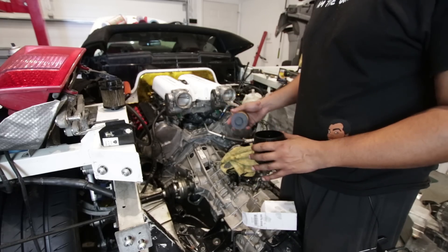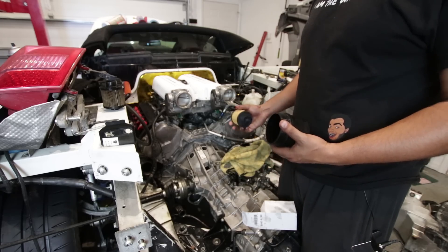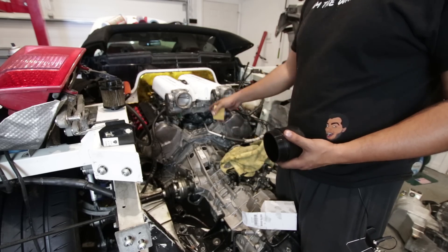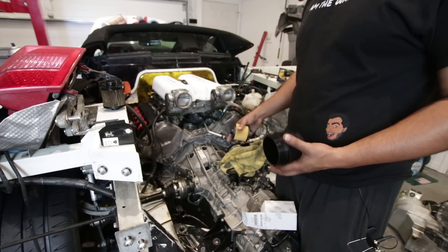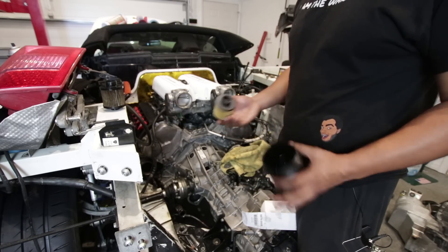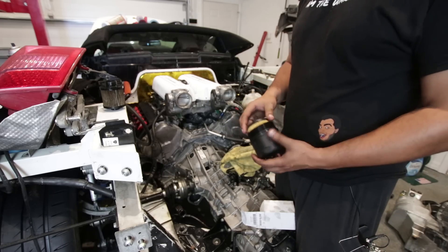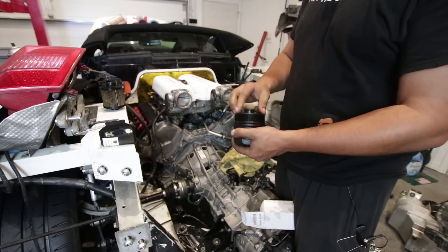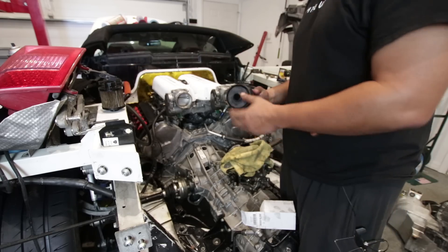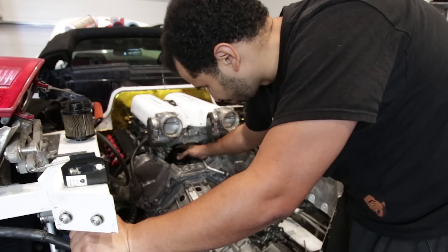For those of you who are a little pedantic about this sort of thing, I will be getting a Blackstone Labs oil analysis on this engine once I've got a few miles on it and made sure it's only been run up to operating temperature without this milkshake-y substance. If I still see it after that, I'll definitely stop and do an engine rebuild. But I think this is really nothing to worry about — those of you with E85 cars who store them for winter and only turn them on for five or ten minutes will know this situation well. I've put the filter back, it's locked in, and all the O-rings are where they should be.